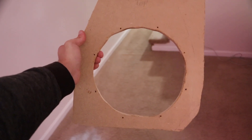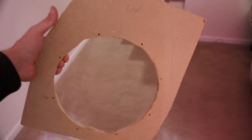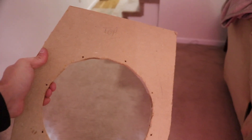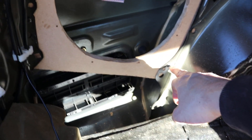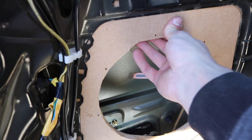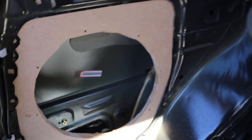There we go — I got a hole cut out. It's not pretty but it works, and it fits in there really snug. Once I dropped the subwoofer in, I drilled pilot holes first, which you definitely need to do or you'll crack whatever you're going through and it won't secure properly. So make sure you pre-drill the holes. I've got screws here, here, down here, one hidden over here — basically keeping this whole thing solid so it won't vibrate. I drilled straight through the metal, then through the wood, and popped a screw in there.